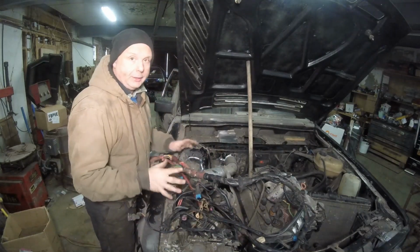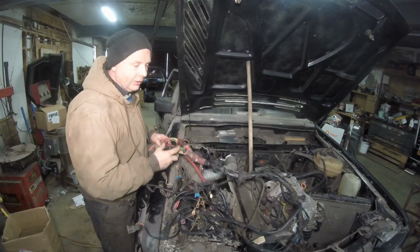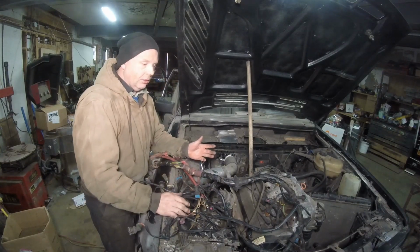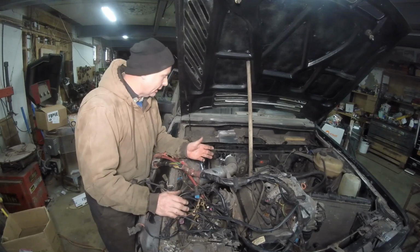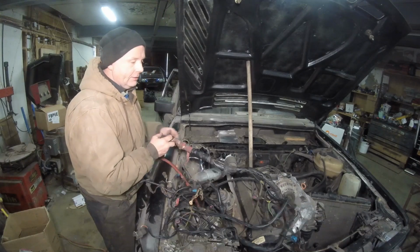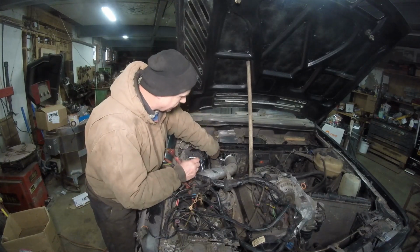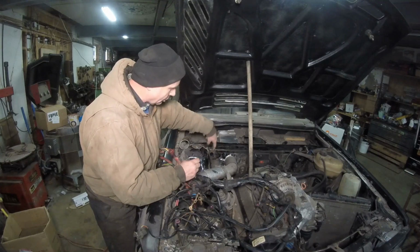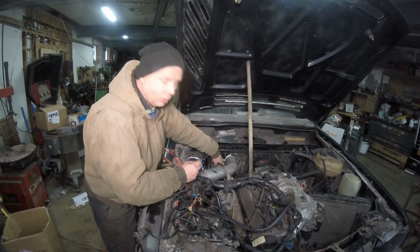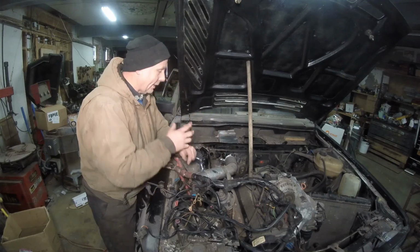This is what we have to put in on the right-hand side of the car. This is the engine harness. It also has all the emission control still in it. It's an uncut harness that I pulled out of a '91 turbo 20 valve. Now, I have two holes on the right-hand side. One hole, I think, was for the original ECU right there, which is probably a 1-inch hole. And I have the big, huge hole down at the bottom for the air conditioning condenser, where that was.